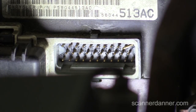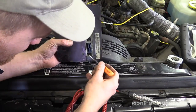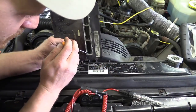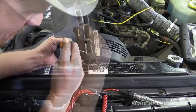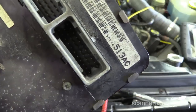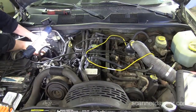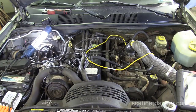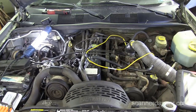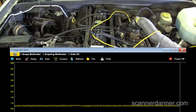Let's try to straighten it and see what happens — if the pin breaks, it breaks. That pin is crushed. Maybe a small pair of needle nose pliers now. Okay, plugging this connector in. Let's see if this thing starts — although our battery's probably dead now. Can you see if it'll start, Pete? If it'll start, leave it run. This is my TPS voltage live still on the scope.